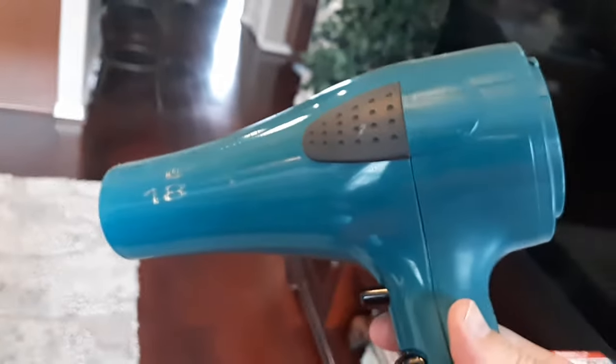If that still does not fix your TV, get a hairdryer — you could technically use a vacuum cleaner but a hairdryer is better. Set it on medium to warm heat with high pressure. Keep the TV unplugged and blow air into the vents, some located up top and some on the very bottom. This blows dust off the boards, and the warmth slightly changes the chemistry — it's actually fixed a lot of TVs. Let it cool down for 10 to 20 minutes, then plug it back in and see if that works.